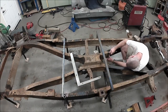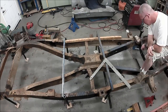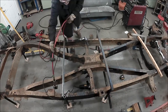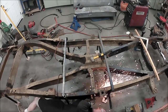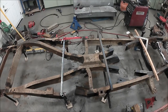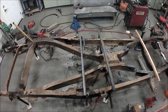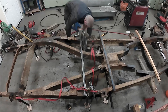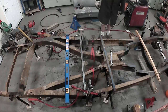Not the strongest cuts, but because it's an X frame, I don't think it'll make a big difference. I'm not an engineer. Even sped up, I'm staring at it going, what have I got myself into? Cutting welds, freeing stuff up, and then out comes the chopper. We cut 12 inches out of the frame right behind the cab, and 11 and a quarter inches out of the frame in the forward legs of the X. Then you've got to suck that puppy all together — I used a couple ratchet straps to cinch it through and some judicious swinging of the gentle persuader. Cut the frame joined up together. C-clamps through the yin-yang to make sure it's all sitting nice and true. Check it for square with diagonal measurements, and I have my level on there making sure it sits at zero degrees all the way across. Leveling all the legs to make sure it's as perfect as it can possibly be, and then when you're satisfied, tack it together.